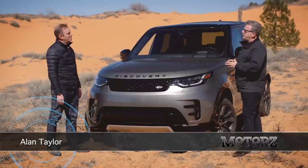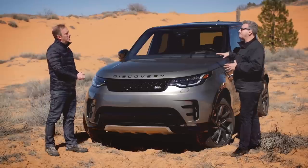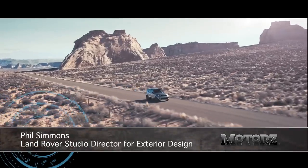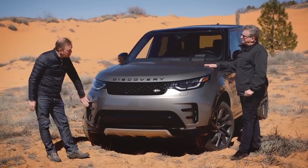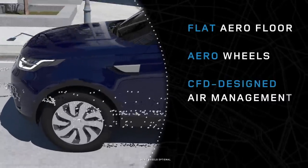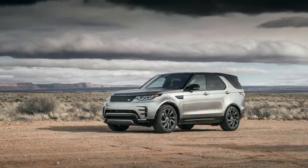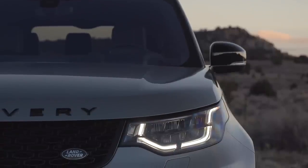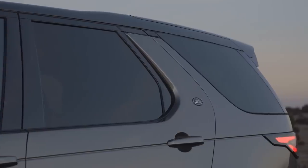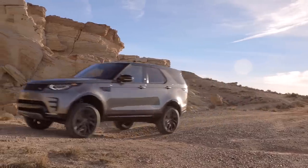Phil, being the studio director for the exterior design of this new Discovery, the front end has a very powerful look to it. And I know that the coefficient of drag on this vehicle is amazing — how did you achieve that? Well, it's a huge number of small improvements, from 0.4 for the previous vehicle to a CD of 0.33. These outboard intakes take the fast-flowing air that hits the front of the vehicle, channel it through the corner of the bumper, and it exits through the wheel arch as effectively an invisible curtain of air over the front tire. Everywhere you look on the vehicle there are examples of fine-tuning of aero performance — around the mirrors, the gap between the mirror and the front glass has gone through numerous iterations. So you get not just an improvement in the coefficient of drag, but lower wind noise as well.